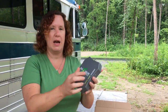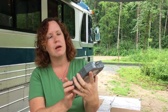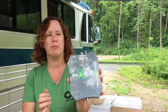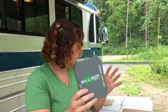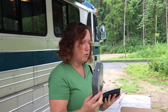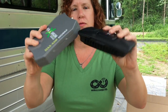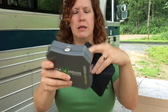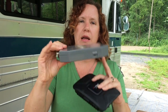This is the amplifier box itself — it is a plastic box, and fresh out of the box I can already see it's got some smudging and a couple of little scratches on it. So maybe this was a model they had in-house that they sent us for evaluation. Compared to the WeBoost 4GX, it's very comparable in size, a little bit larger of a footprint, but very similar. Like the WeBoost, it's got an inside and an outside antenna hookup, and the power supply is on the side. It uses TNC antenna connectors.